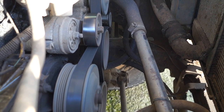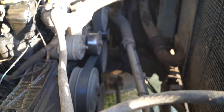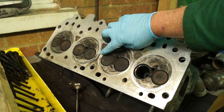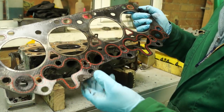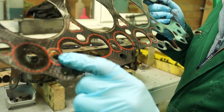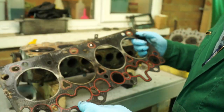You can hear this engine chuffing — it actually came through the head gasket and not the exhaust as we first thought. You can see very clearly on the cylinder head where the gas has been blowing through and has built up carbon, so this has been blowing for a fair while. This cylinder head has had a head gasket failure between number two and number three. Also on the gasket you can see if you've had cooling system problems, because the water galleries to the cylinder head should not be blocked. If those ports are blocked, more than likely the cylinder head has been overheated.